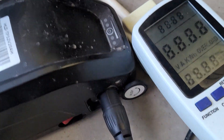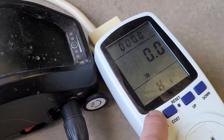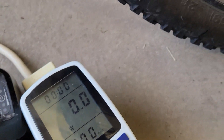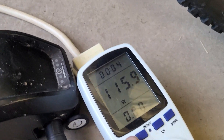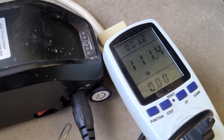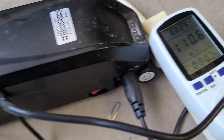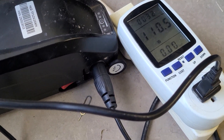I've zeroed out the kilowatt meter — hit the reset button — we've got zero kilowatts, 124 volts, 60 Hz, no amps, no watts. We'll plug it in and see how much it takes to charge from the shutdown voltage. This is a Bafang BBSHD 1000-watt motor; the shutdown is 43 volts at factory settings on the 52-volt setting with the 500C display.